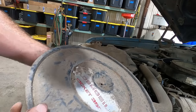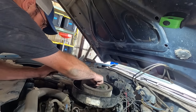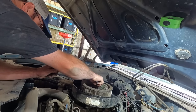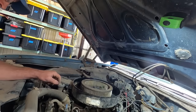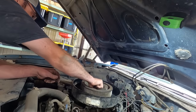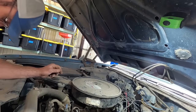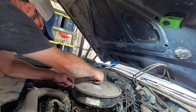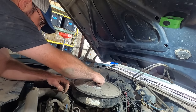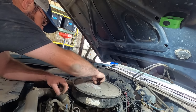I'm gonna go find a wing nut. Here you go, one quarter inch wing nut. So right up there with Cragars and flexi hoses is people with incorrect hardware on their air cleaner hold downs. And it can be remedied so easy. Look at that. You get rid of that silly 3/8 nut that they had in there for a spacer. You don't need a tool to take it off if it's lighting on fire on the side of the road or the float's stuck.